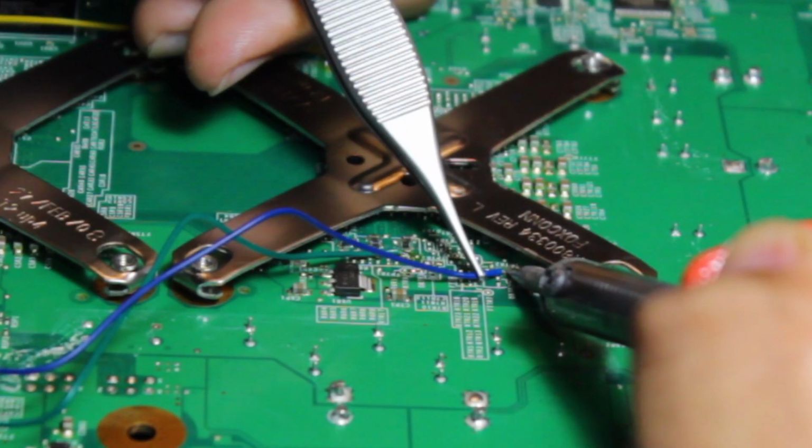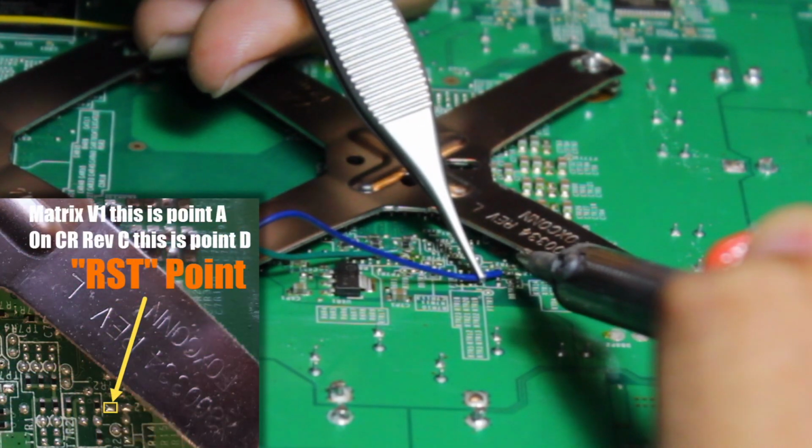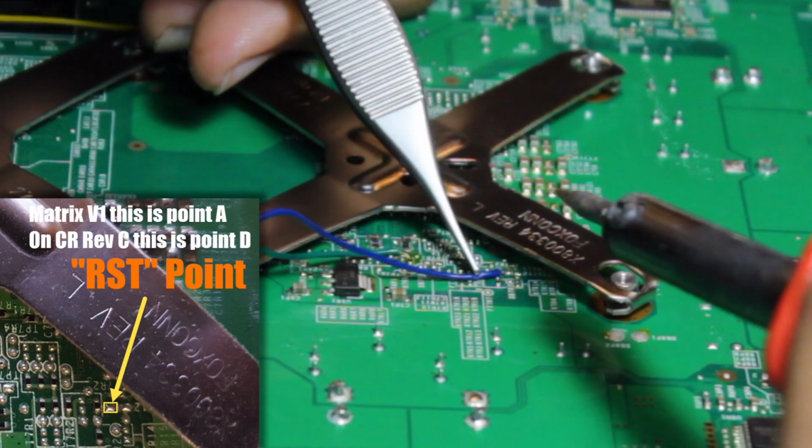For the blue wire, just look to the right of the green wire at the end of the X clamp. You should see 2 mounds of solder and a dividing line. The blue wire needs to be soldered to the mound on the left.